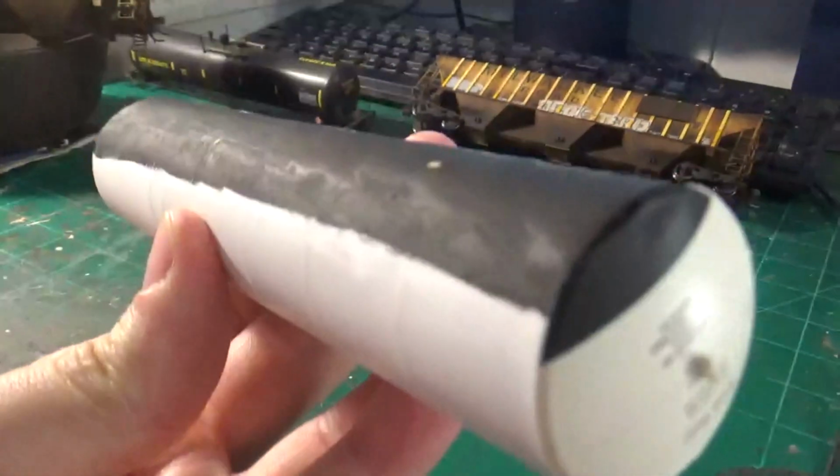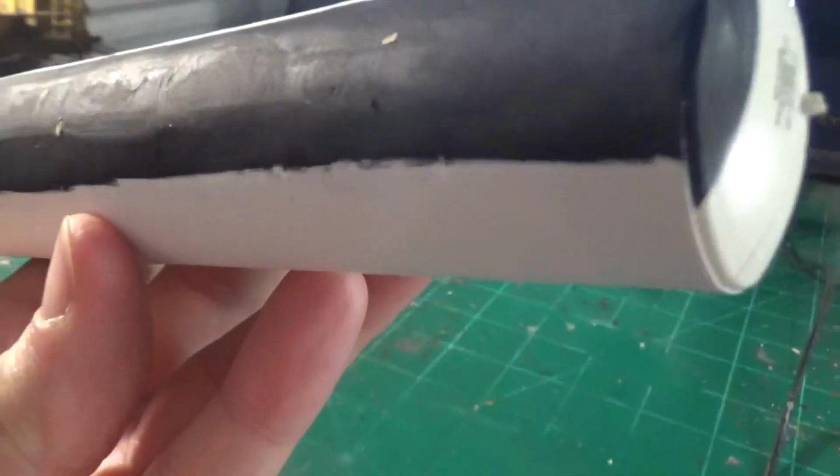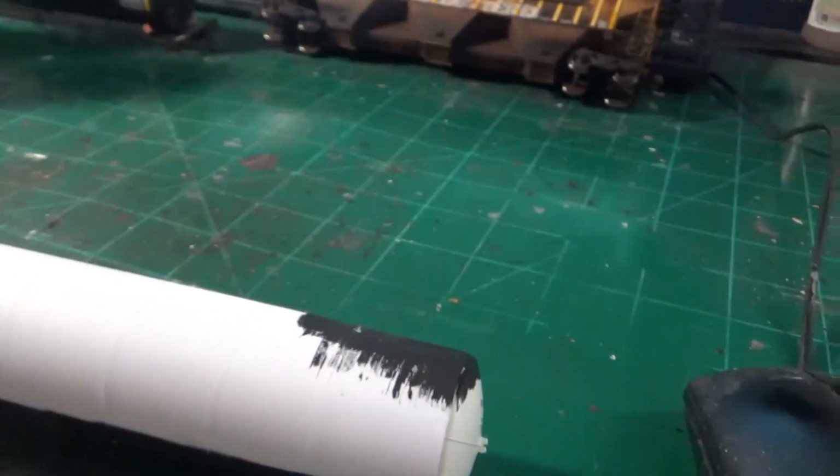The reason this one has all this black on it was because I had to body putty quite a bit of damage to the seams and try to blend some of the dents out that were caused by the sanding and things of that sort. You can see even that, and it's still not exactly perfect, and it's what it is. At the top here, this got damaged, so I had to putty and fill this. So hopefully that all paints out okay.